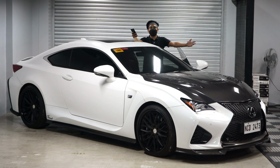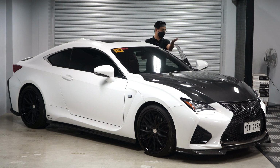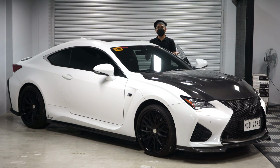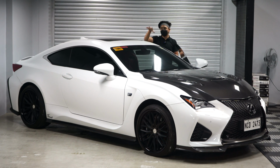While we're at P3, as you can see, the car can lift up really high off the ground. We can still lift up the front. This is very common for double wishbone suspensions and multi-link rear suspensions. They tend to have very long suspension travel, thus translating to a very nice ride. This is not yet the maximum height, but there is no time to discuss.